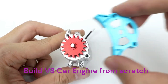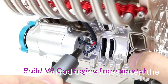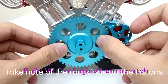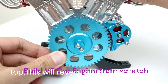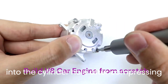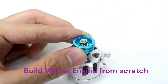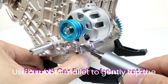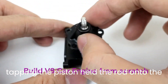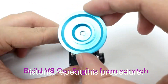Step 4: Reverse the block's direction. On one of the piston rod assemblies, insert the rod bearings into the bearing caps. Take note of the markings on the piston's top — this will reveal which direction the piston enters the block. Set the piston into the cylinder hole after compressing the piston's rings with a ring compressor. Use a rubber mallet to gently tap the piston into the hole as needed. While tapping the piston, guide the rod onto the crank journal. Repeat this procedure for the remaining seven pistons.